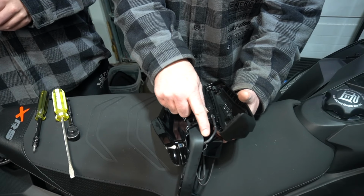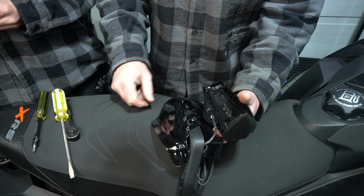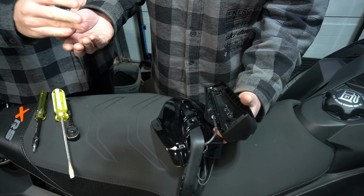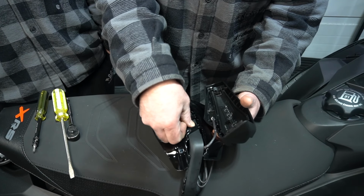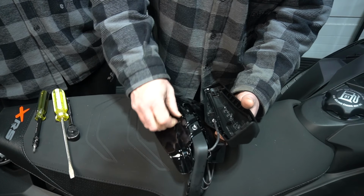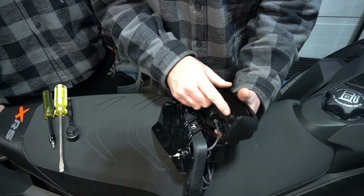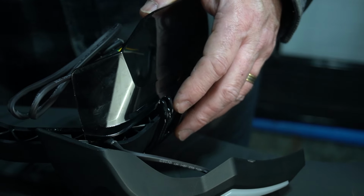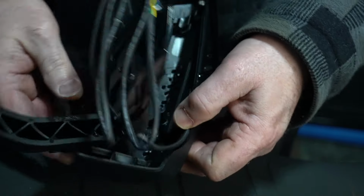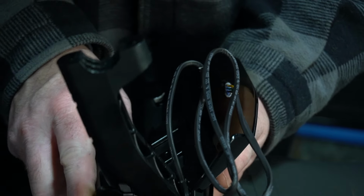Okay. So we got the wire in place, and now there's a little aluminum spacer that we're going to drop into the handguard and press in. It just fits in there like that. Okay, and that just keeps that from going too far, I think. So I'll make sure that wire's following along those guides, and then we'll pop that clip in like that.